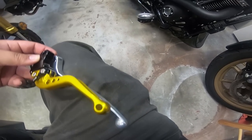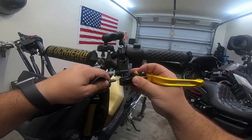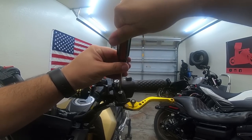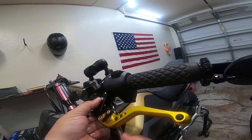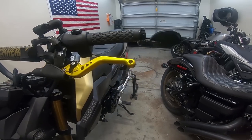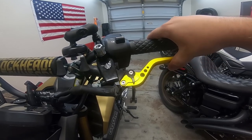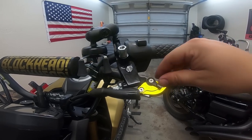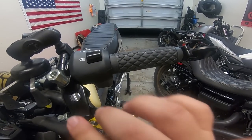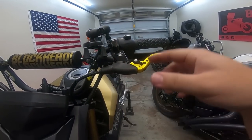That is the difference in length, and these are adjustable which you'll see here in just a minute. Installed on that side — those levers are pretty bright. Basically just tighten this back down after you've adjusted your lever. You want a little bit of play in it, but you want enough tension that whenever you grab it, it pulls the clutch cable. Adjust these to your preference — at one they're closest, and as you go up they adjust further away, based entirely on what your preference is whenever you've got a hand on the bar.